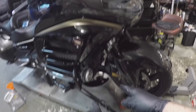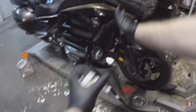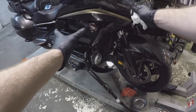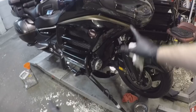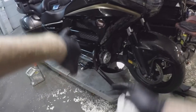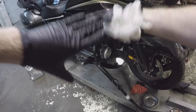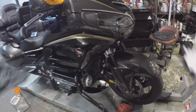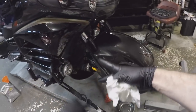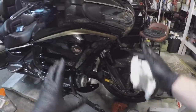When you're going back in with this front lower cowl, work one side in first. Get it up underneath that lip like we pulled it out, and then you can work that other side in as well. So slide one side in — don't try to get them both in at the same time, you're going to learn a whole other set of curse words trying to do that. Just slide it into the right first, or the left, whatever side you want, and then kind of pull the fairing back and slide it up underneath that edge. Work with one side, then the other. Everything else is just the reverse order of how you took it apart — very, very simple. Remember that the short screws go into the two bottom and the long screw goes in that one top position that goes through all those plastics. Get all that lined up and that's it.